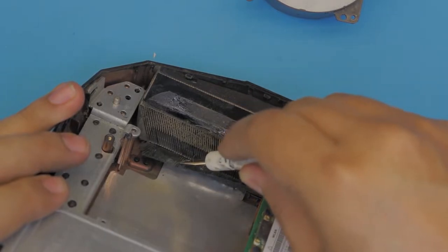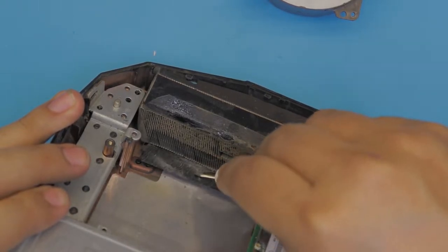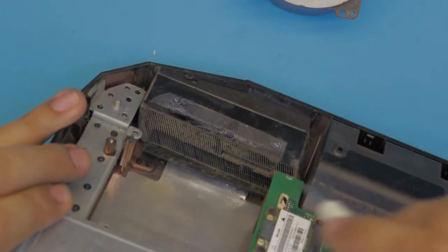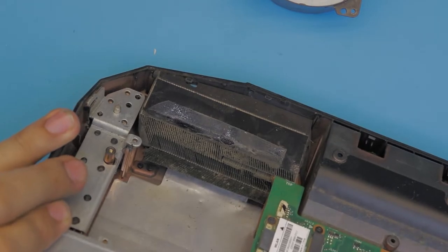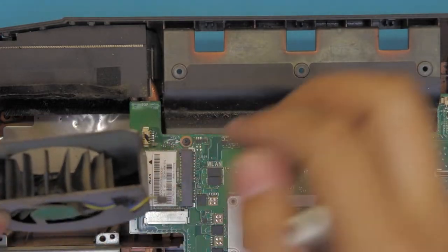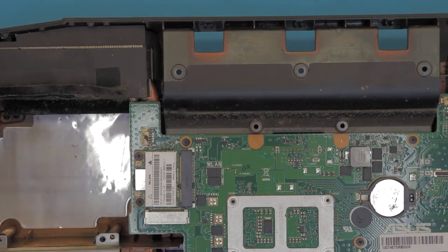So if you just bought a new one, I suggest you open it up to here to open this tape right there, so you won't block the ventilation right there. That's a humongous gap right there. It was only about 1 centimeter of heatsink. So yeah, I don't know how the other one is, so we're gonna check. It was pretty much blocking half of the fan right there, so almost half. That's about a 30-40 degrees difference from airflow.